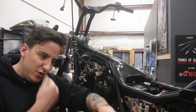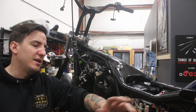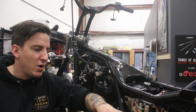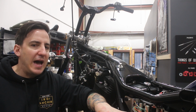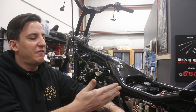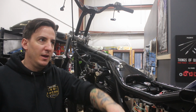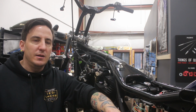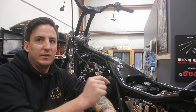So maybe you're watching this video and you're thinking, I've got an FXR, I've got a harness and everything works because it's a running, riding bike. I want to ditch the circuit breakers and I want to run one of these units. The question you might be having is, can I do that without totally replacing the whole harness, leave the factory harness in place, and just connect it to the M-Unit? My answer would be yes, you can, but it would not be nearly as straightforward as just disconnecting wires here and plugging them into the M-Unit.